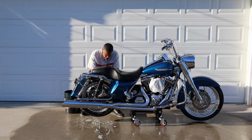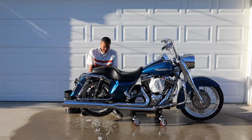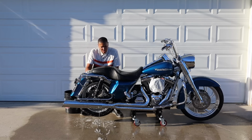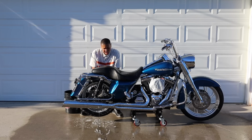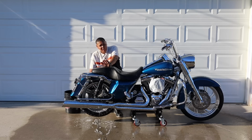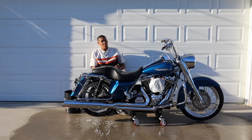In those cases when you're making over 150, the only time you really will know when you need a chain is when you take it to the drag strip. Because on a treated surface, tire deflated a little bit, the bike's going to hook up, and then all that initial shock of power can snap a belt. People do break belts, but it's harder than you think.